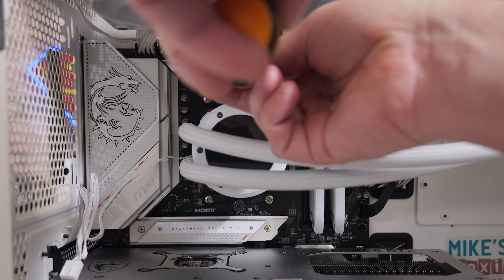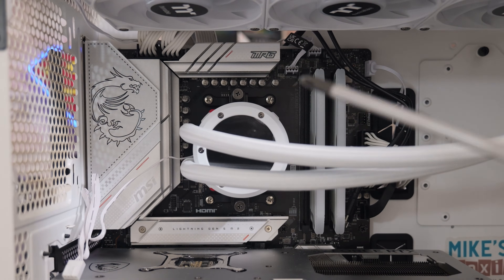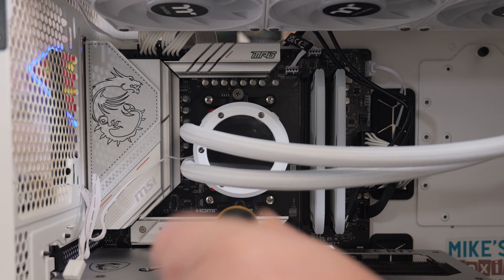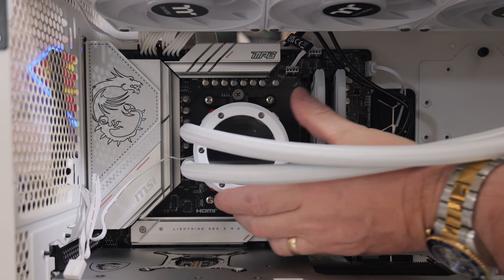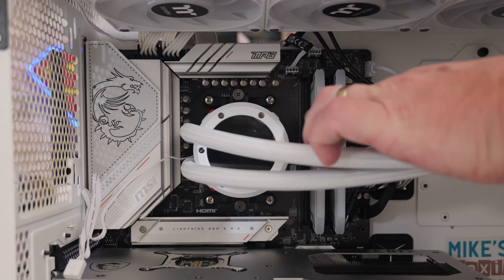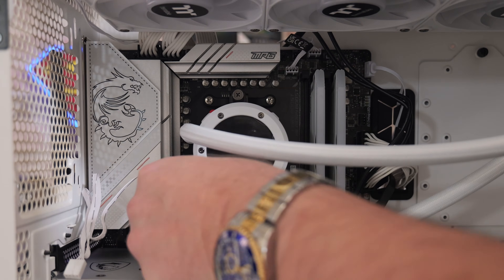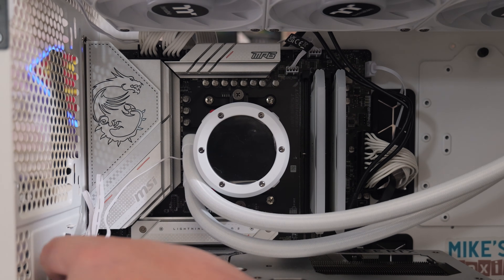That is basically at the bottom now. With AM5, my suggestion — because there's sometimes an issue with how much pressure is on the CPU — just back off a couple of turns, two turns backwards. Then just make sure the pump is still firmly in position. That's going to be the optimum pressure setting. You don't want too much pressure, so don't screw the screws in all the way so they bottom out, because potentially you'll get an issue where it moves the pins on the tiny pads underneath the CPU, and your system won't boot — you'll get a CPU light error or a CPU and DRAM light error. Now we can move the pipes into a more appropriate position, bending them down a little bit so you can see more of that glorious IPS screen.